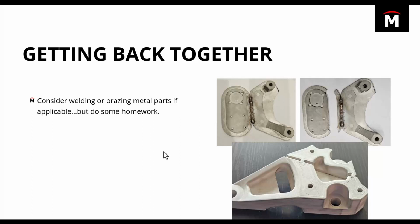So we started off by taking a couple of scrap pieces, and I did this several different times, with either scrap metal printed parts, old parts, or just the rafts that are left over when we print some of these parts out, and I would try and weld them up. I tried welding them with a number of different filler materials. This was all TIG welded, by the way. I also tried brazing. What I would do is weld these parts together at the seams, throw them in a vise, and hit them with a hammer and see where they break.